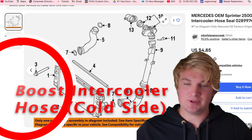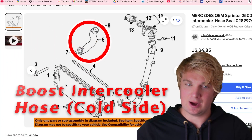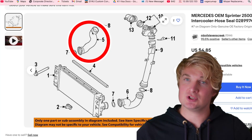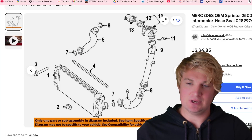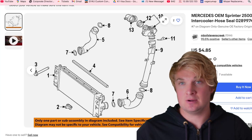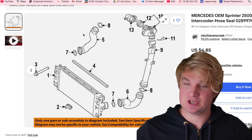The second place to look is the cool side. Even though the boosted air has cooled down after passing the intercooler, you still want to check this side simply because it is prone to break — they're rubber hoses and they only last for so long. So step one: hot side. Step two: check the cold side.